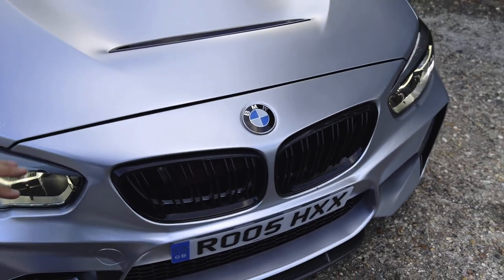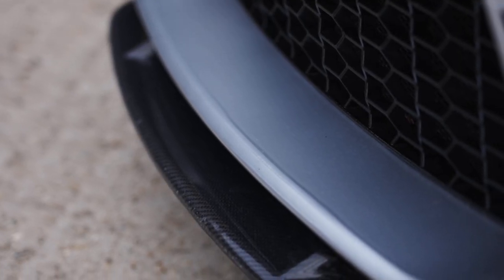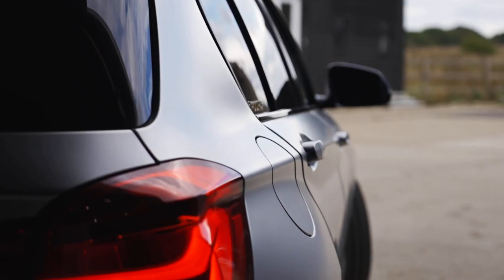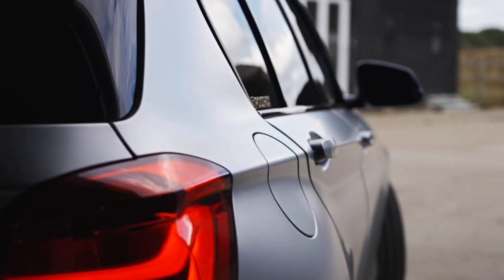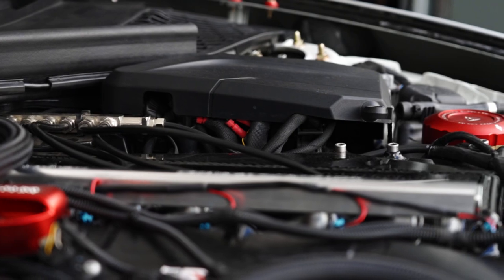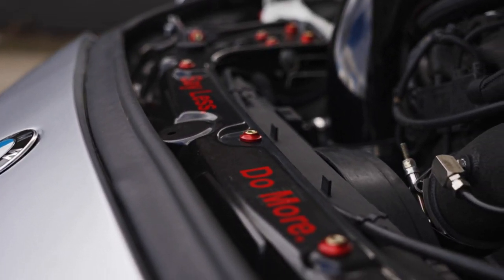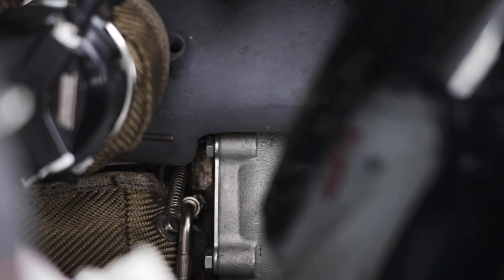There are a few nice little upgrades on the aesthetic side of things - CT carbon front and rear, M2 front and back, and a wrap by AJ's Atelier. So to give people an idea, we've got a built engine - pistons, rods, custom fuel setup, so port injection with port methanol. Big boost G35 1050 Garrett.